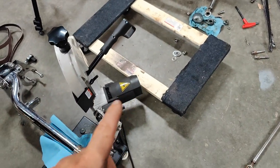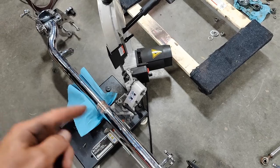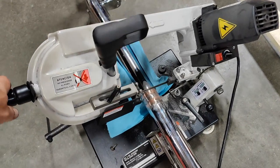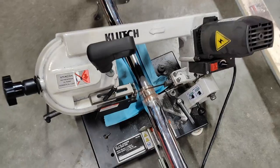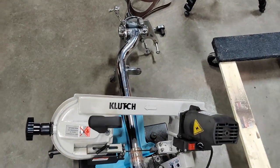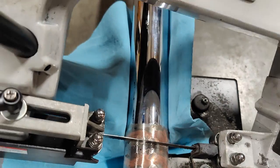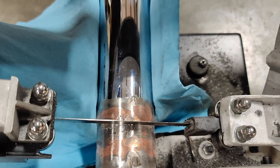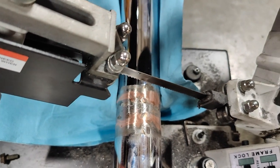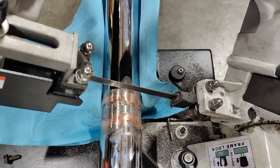I'm finished sanding for now. I took the center link off just to keep it out of the way, and I picked up this little bandsaw a little while ago — it cuts really nicely through tube and this is going to be a perfect use case for it. I've got the axle mounted up in there, and now comes the uncomfortable part of cutting it in half right at the weld. I don't know exactly what it's sleeved with — the previous owner said he sleeved it with something solid — but hopefully it's not actually solid all the way through. I guess we'll find out.